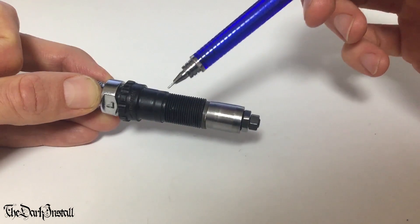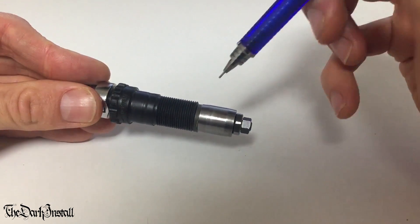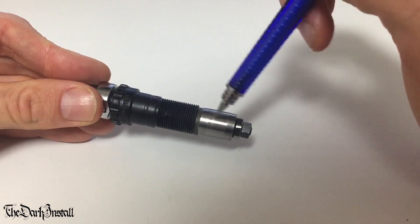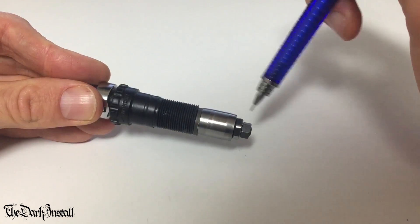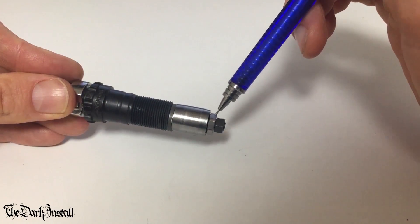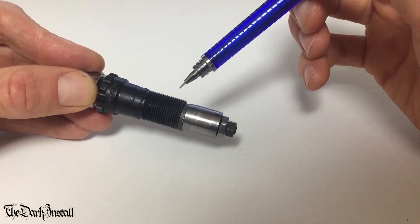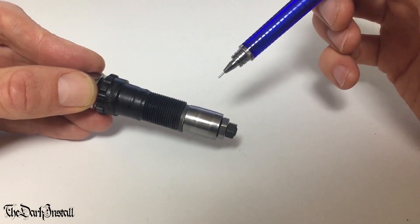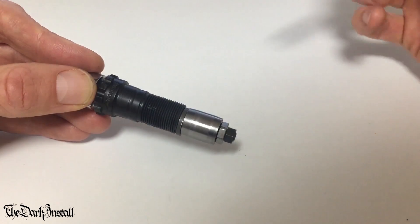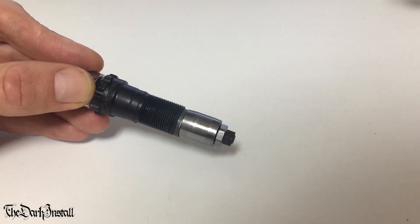This axle assembly is the same on the 105 pedals. Now on the Dura-Ace pedals, the bearing assembly is slightly different - I'll go into full detail in another video. But to summarize, the Dura-Ace 9000 bearing system has a bearing here, a needle roller here, and some loose bearings which sit freely in the bottom of the pedal body as the axle thrusts in. There's not this locking nut system on the Dura-Ace 9000. The Dura-Ace 9100 is different again - it's the same as the 9000 except they've taken out the needle roller. Nobody has tested the 9100s because they've only been out for a few months, but if they were designed by the same team, I can't see why they wouldn't work.